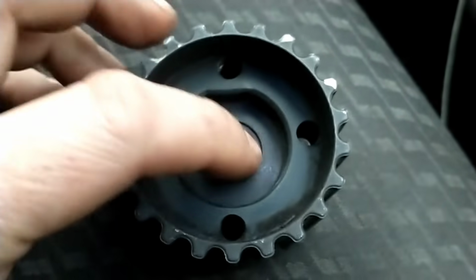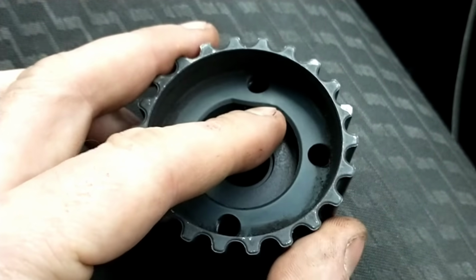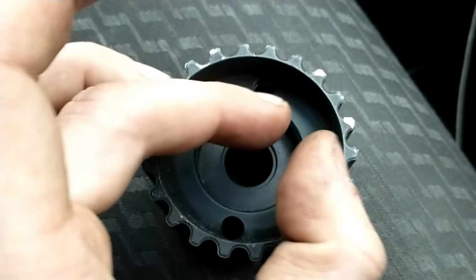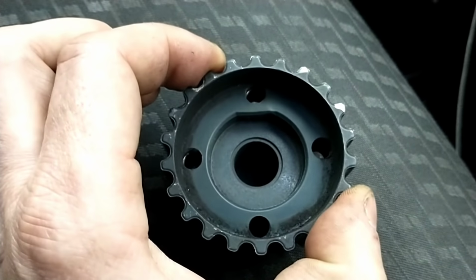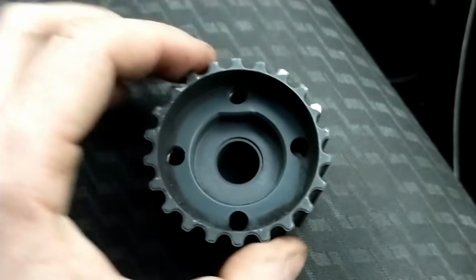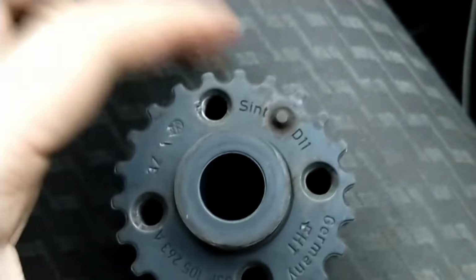So if it moves the tiny amount on the inside, it's going to move into that indent, and obviously because the wheel is bigger, the small movement on the inside is a bigger movement on the outside of the wheel here, so it's going to be out by half a turn, or half a tooth, and that would trigger off that fault.